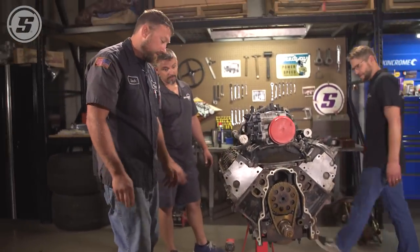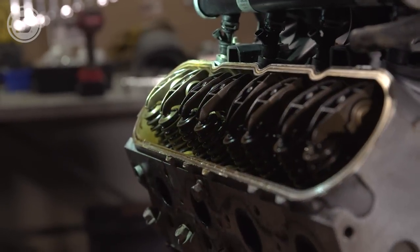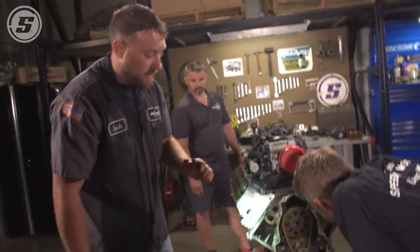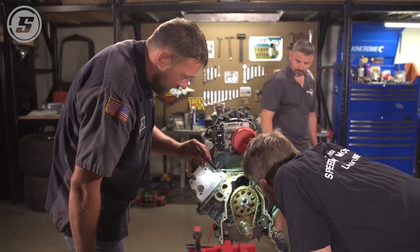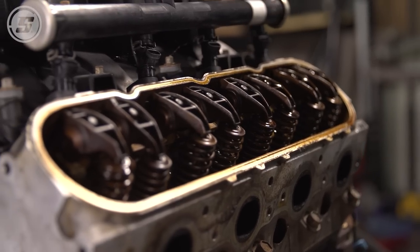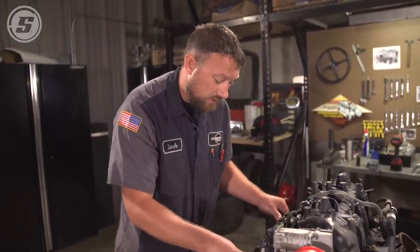Wow, that's really clean — that looks beautiful, actually. Is that the PCV side? The oil fill cap was broken off inside of there, but short of that it looks great. Does the timing set look okay? It doesn't look too bad — I pulled a new one if you wanted. It's loose, but when you put a new one on it's not going to be substantially tighter than that. There's the PCV side — just a little dirtier. Get these rocker arms off and put them on the bench and inspect them for wear and make sure everything looks good.